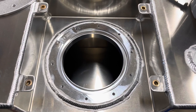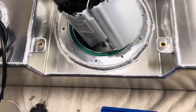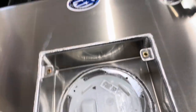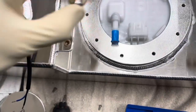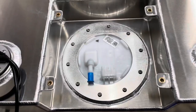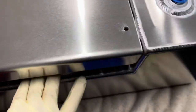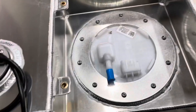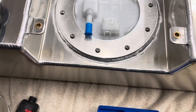I do really recommend them. Basically, just have to put the o-ring on, drop the fuel pump down in there, clock it correctly — it's keyed right there. Take your flange, put your flange on there, and then grab all your screws and bolt it all together. Pretty simple. There you go, bolted down and installed. Then there's this cover right here which covers everything, and it still allows room for your fuel line and also your wire harness to come through there as well. Just have to get a GM connector for the fuel pump and then run a three-eighths inch fuel line from there to the engine.